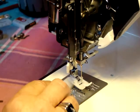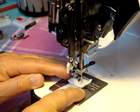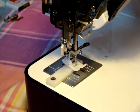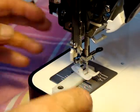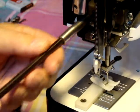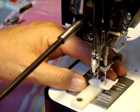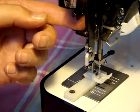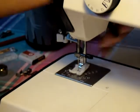Then you want to check your height again. You notice that the distance between the bottom here and the top there — there's quite a gap there because the thickness of this foot itself was thicker. So now you're going to have to lower that back down. If you've got this type of foot, just loosen that little screw on the pressure foot and lower it down. There we go — that's lined up there. We're good to go for that height. Remember, quarter of an inch.